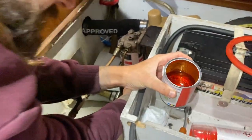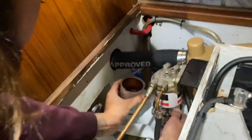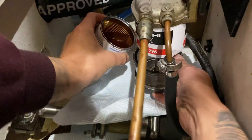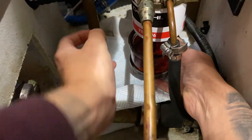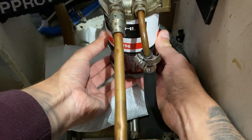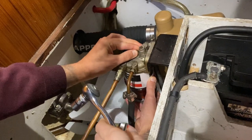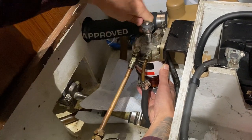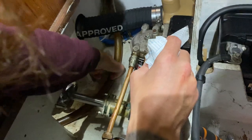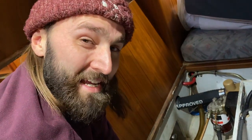Put the fuel filter back up into there, it stays where it is. Bringing up the reservoir, I want to sort of pre-fill the reservoir so that when we go to start it doesn't have to fill this first, giving it a better chance of going. The glass bottom and the metal bottom are independent from each other and I don't want to start pouring diesel into it and then have it draining out — so it's just going to be a bit precarious. With the help of some Asda beans — make sure whatever you use is clean — I'm just going to pour it in.